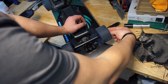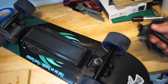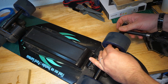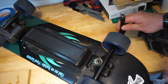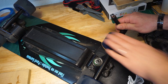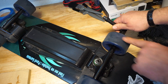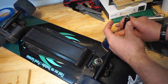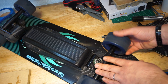You put the nut on, then it gets to the point when you cannot turn it anymore by hand. At this point you have to use the tool. What I do is put the nut on the axle almost until it starts touching the actual bearing, and I spin the wheel. I keep on tightening the nut, and as soon as the wheel stops spinning freely I back it off about this much.